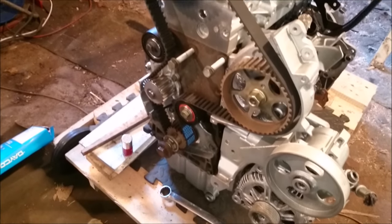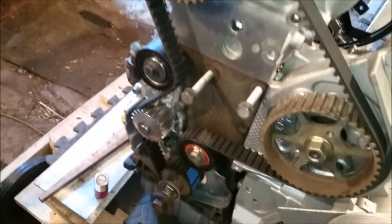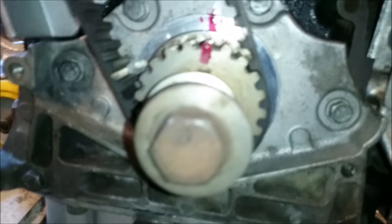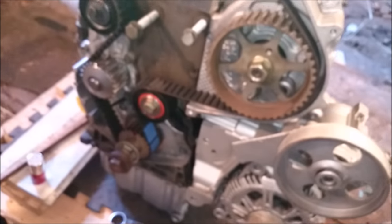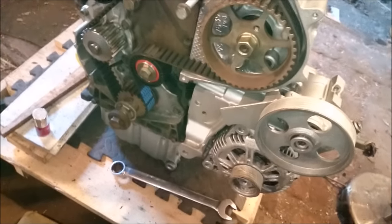That's it timed up - that's it for this episode. It took a little bit of fiddling to get it right; every time we tensioned things up it would take it out by half a degree or so. Just for helpfulness for future reference, I've used some nail varnish - not Tipp-Ex, because that seems to rub off - and popped it on a tooth there. I've also marked up a tooth on the flywheel and made a little mark on the gearbox. I wouldn't rely on that alone - I'd still use a dial gauge - but for future reference, if I'm a bit worried something isn't right, I can just stick a pin in the top and check those two marks and make sure everything's okay, just to eliminate any issues.